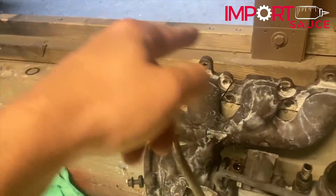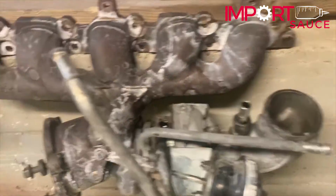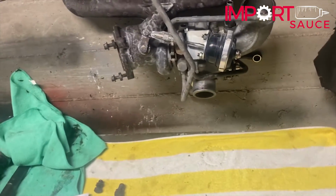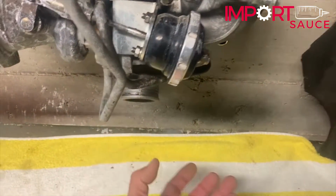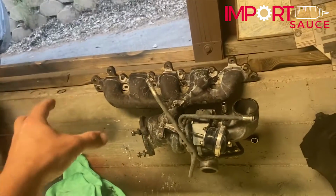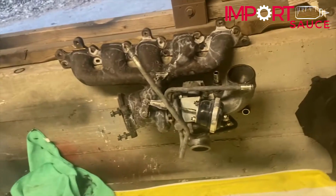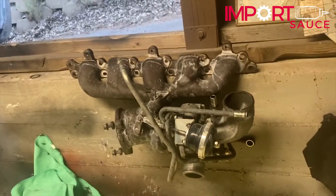So the air comes through and then drops into this air inlet, right? And then as it is interacting inside the housing here, it is going to spin and pop out the bottom. And this is where your, I'll call it the hard pipe, as Elevate calls it. We have the Elevate hard pipe, which then takes this down, and it crosses under at a diagonal and pops into your intercooler up on the driver's side. It then goes from driver's side to passenger, and at that point it creeps up and feeds into your intake plenum, intake manifold, throttle body, you know, that whole assembly there before it enters the block. So that is the airflow on these guys.